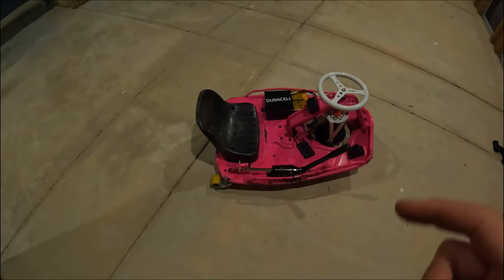And what I mean by that is riding properly is learning how to feather the throttle as well as use your weight and the steering wheel to your advantage to allow the front tire to grip up and not spin so much. And this will save your tire life by so much. I get roughly 35 to 40 miles out of a tire if I'm riding conservatively or if I'm riding normal. If I'm just going crazy, not worried about it and just having fun, or my tire is at the end of its life and I'm about to replace it, I'll just go crazy and do rolling burnouts through corners and things like that and smoke the tire up. It sounds awesome, it looks awesome, but it is not good for your tire life.